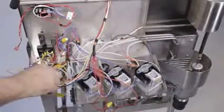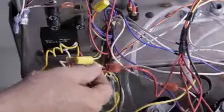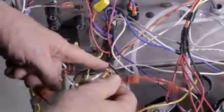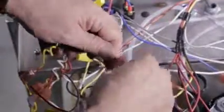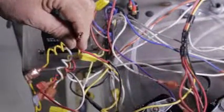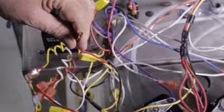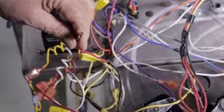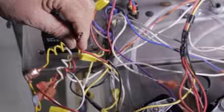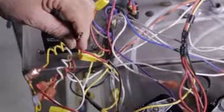Wiring the relay switch. This will be done with the quick start timer and proximity switch installed. Locate the red wire coming from the on-off switch. Separate the 1/4 inch male and female connections and make sure that the wire coming from the on-off switch ends with a female connector. Replace the connectors if needed. It may be necessary to cut the main red wire on some machines to accommodate this necessary break in the power. If so, you will need to install the 1 male and 1 female connector.